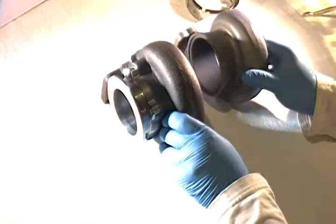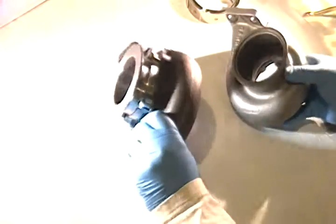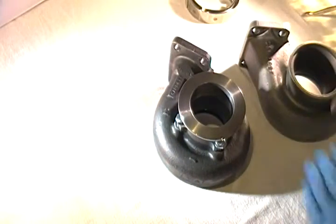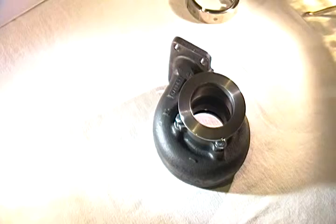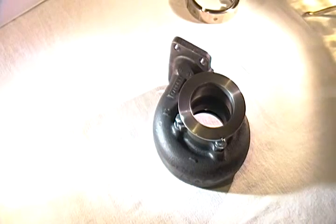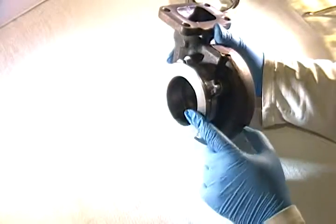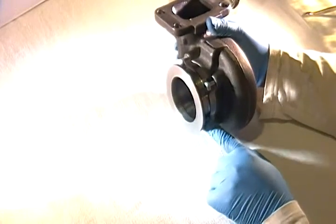If you compare that to it, they're about the same distance. What are the drawbacks? Because there's always some sort of drawback. It's not as cool as a housing that has an integrated V-band flange into your T3 housing, especially for those reserved for it. And a slight drawback is that for those with tight, cramped engine bays — especially those wanting to keep air conditioning or other amenities within a front-wheel-drive application — you may have some difficulty fitting the entire flanging system into your downpipe.